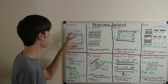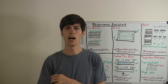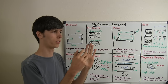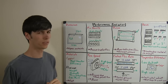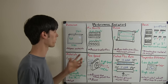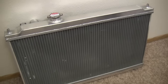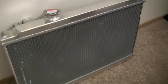The first I'd like to talk about is the dimensions of the radiator. Preferably you want a radiator that's very wide, very tall, has a great frontal surface area, and is very thin — that's the best way to get the heat rejection you want. The thicker the radiator, it starts to build heat within it and you don't get as much cooling. The problem is space constraint; you can't just place massive radiators inside cars, so they do have to have a decent thickness for increased cooling. Overall, this is a fairly wide, tall, and thin radiator, taking good advantage of the space in the front of the Acura Integra.